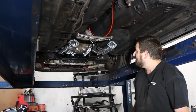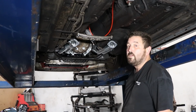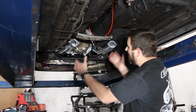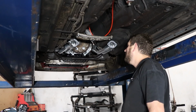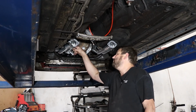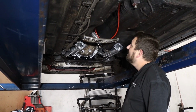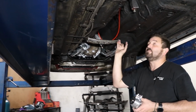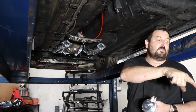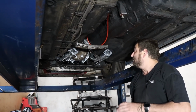It is heavy. So up the front here, these are those Toyota Soarer or SC400 headers that Hurricane make. They're pretty much bang on. We've had the Powerglide up there, everything fits. We may have to shorten the lever a little bit to get it to clear here, but other than that, it's fine. So the idea is we're going to do single or twin 2-inch feed pipes to the back to try and make use of the split pulse effect.